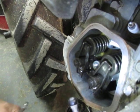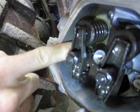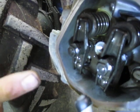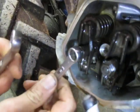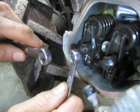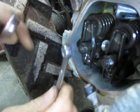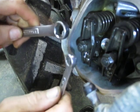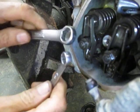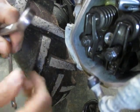Now these studs in the middle here — this is a stud coming out from the cylinder head, threaded into the aluminum cylinder head. We have seen cases where this causes a problem. The process for doing the valve adjustment is: you loosen up the little jam nut on top to release the tension on the main adjustment nut, crank the adjustment nut down a little bit to tighten up the rocker arm, and then re-tighten the jam nut. But if you're not careful when loosening the jam nut, you can actually loosen the entire stud from the cylinder head. If you do that and don't know it, it gets out of adjustment in about five minutes because the whole stud is backing out and just loosens right up again.